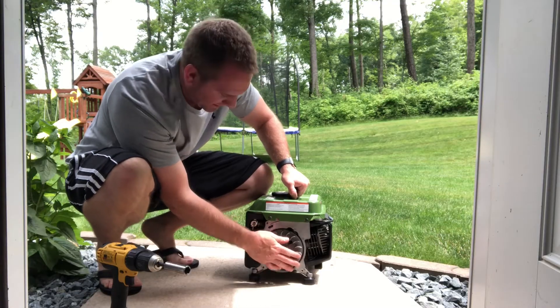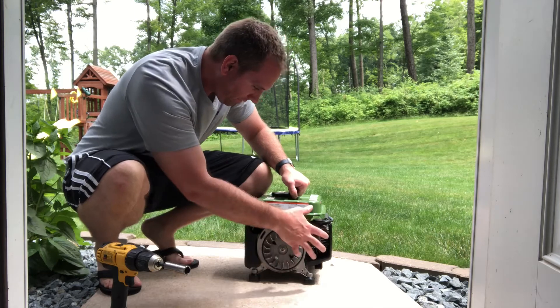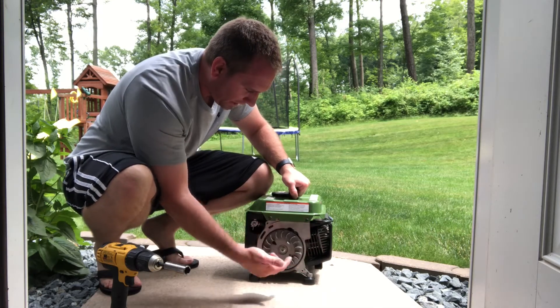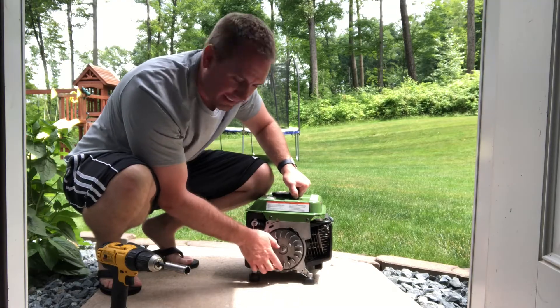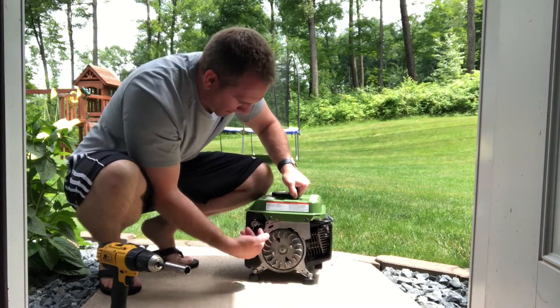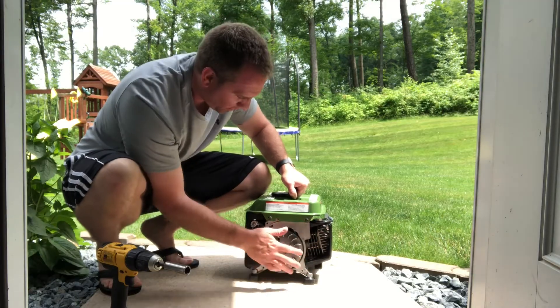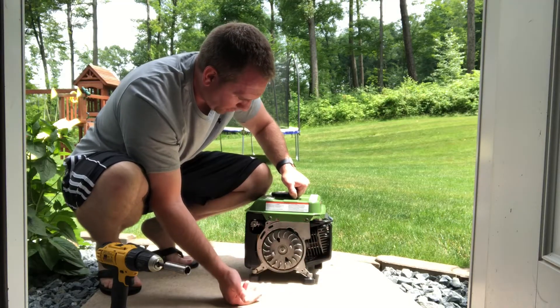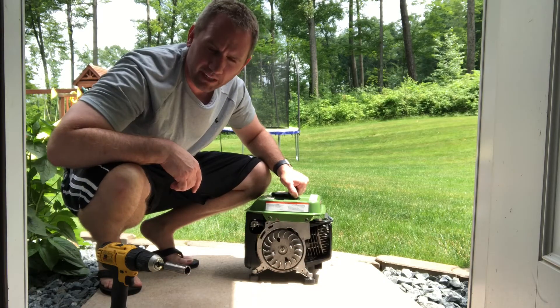I'd love to leave it like this, but I can't because that is a duct for the cooling air. The flywheel here is basically a fan — it brings air in across this side and directs it over the cooling fins on the engine. So we can't just leave that off without the risk of overheating. Let's take a look and see how we can modify it to make it work.